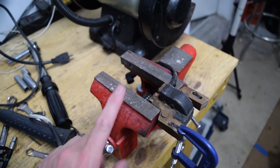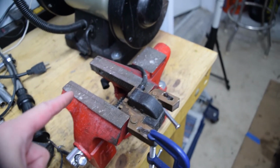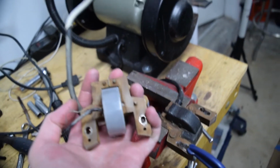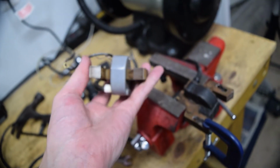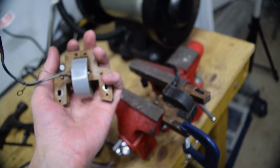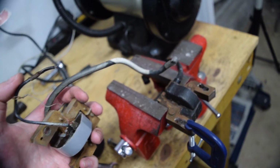Okay, so where I'm at currently is, I went to try to start it, realized there was no spark, then did some Googling to try to figure it out. Turns out that I'm an idiot, and the coil that I took off is set up for points ignition, not electronic ignition. I didn't realize this, but the thing I'm trying to do is convert to electronic ignition without realizing it. This coil is not going to work unless I pull the flywheel and reconnect the ignition signal back to the points.